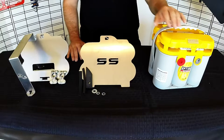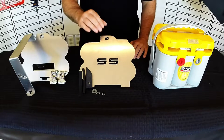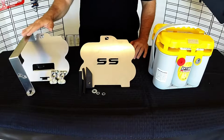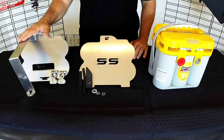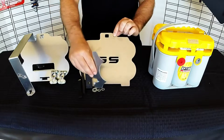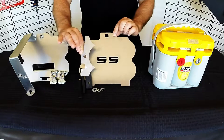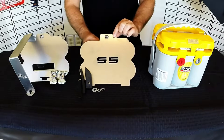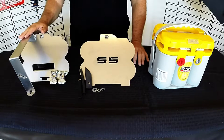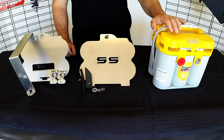We'll talk about the Optima in a few minutes, but I want to go over a few details about both battery trays. This battery tray was designed specifically for the 2015 Slingshot, and this one was designed for newer Slingshots that came stock with a smaller battery. The 2015 tray comes with everything you need to install it, plus a mounting bracket that holds the battery secure so it can't move around or vibrate and cause damage. The 2016 tray looks slightly different and also comes with extra battery terminals that fit a full-size battery like the Optima.